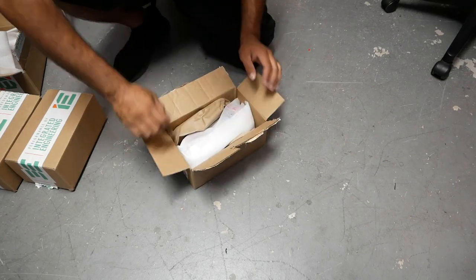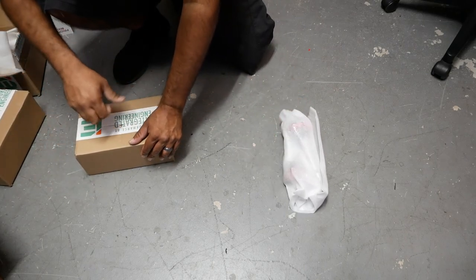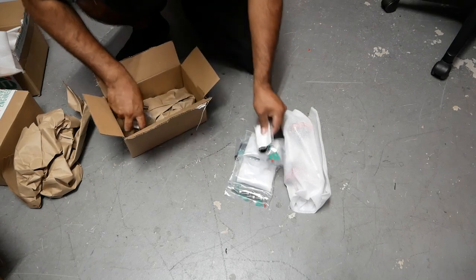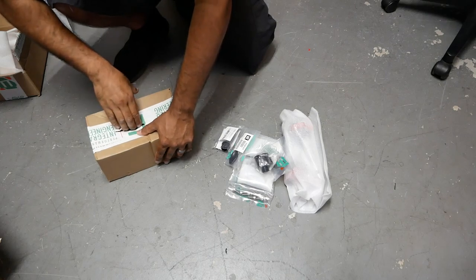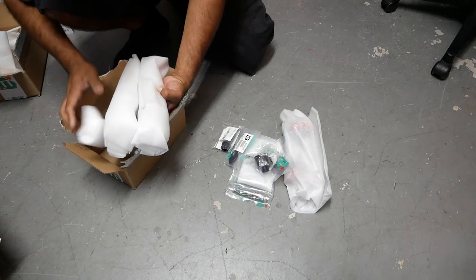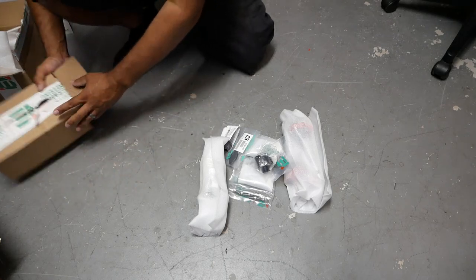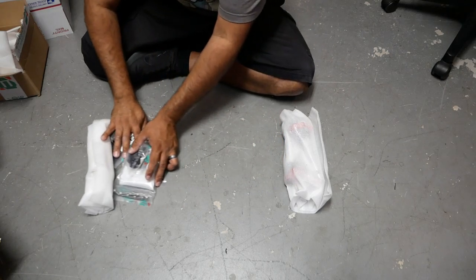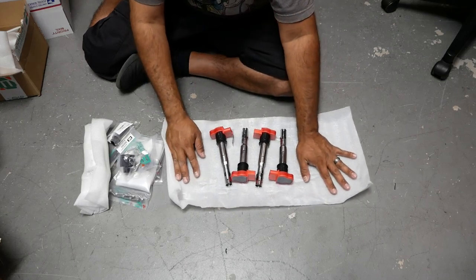Let's see what we got. Starting with what's in red — we got Audi R8 coil packs, 2.0T ignition coils, four of them. The reason I go to a 2.0 coil pack — number one, cost. They're way more cost-effective than a factory 1.8T ignition coil, so you're saving money going to a 2.0T coil. At the same time, you do have to spend a little more on adapter plates to make these fit correctly on your valve cover.